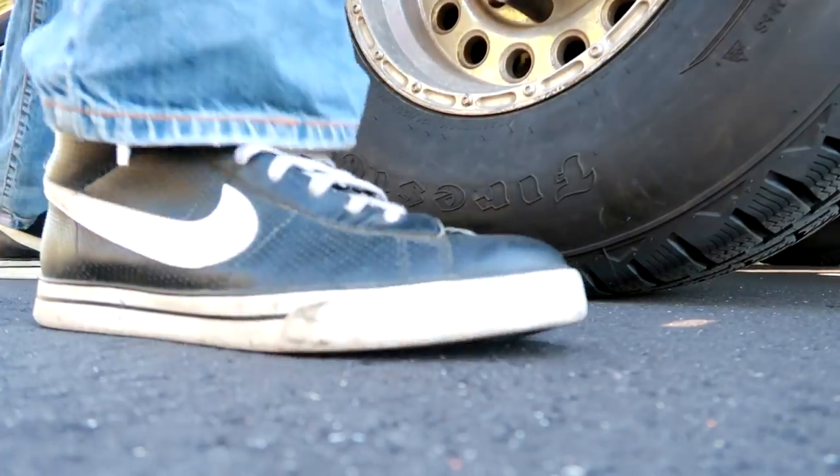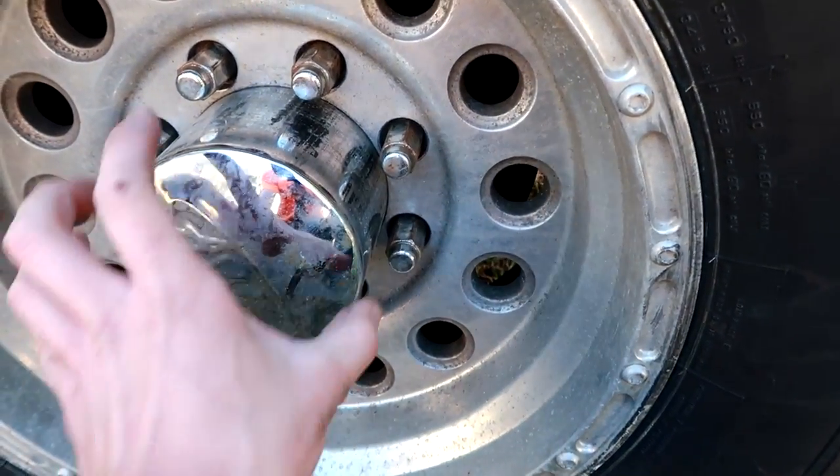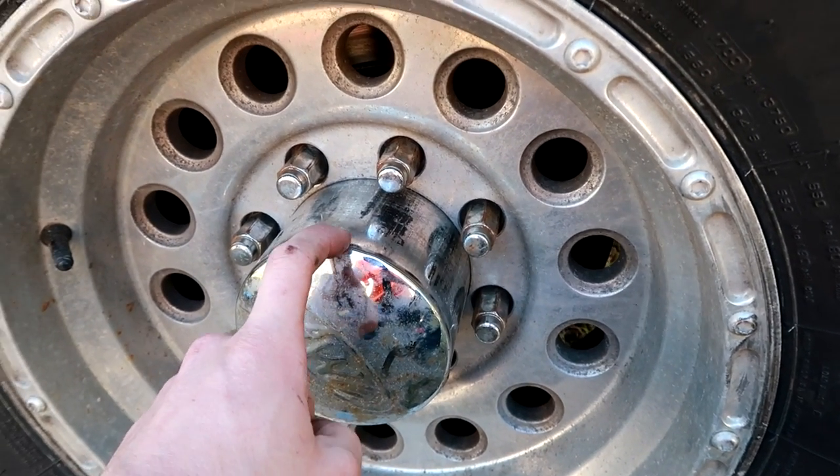I got my wheel on my truck. I'm moving — you guys can see I'm taking it around the block making sure everything's gonna work right. I've done everything correct so far, other than re-torquing the wheel down, but I'm not going very far — just doing a little lap. Making my first stop; so far the wheel hasn't fallen off. The pads probably got worn unevenly for a little bit since my wheel fell off and the caliper was riding sideways, so it's not a surprise that it's making noises or smoking. I just gotta check the lug nuts every once in a while — everything is done correctly. I re-torqued the axle bolts that go under the hub before I put it back on. I've torqued these probably about four times; once I go a couple more miles I'll torque them again. So the Duramax is open for business.